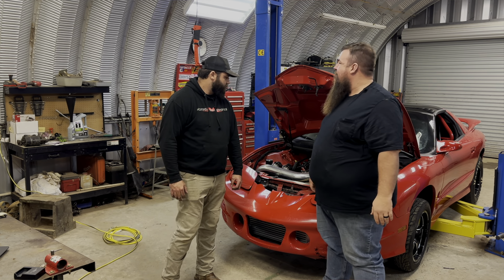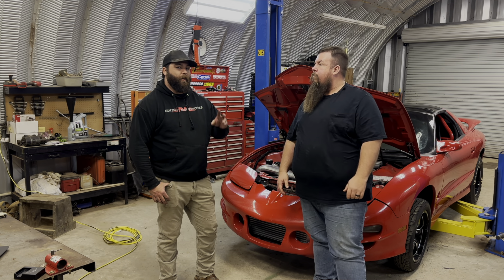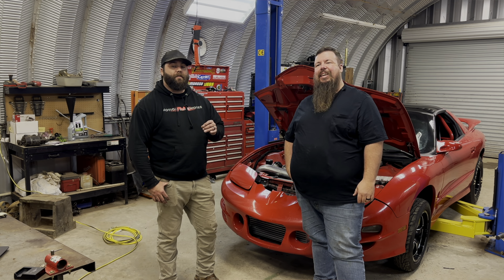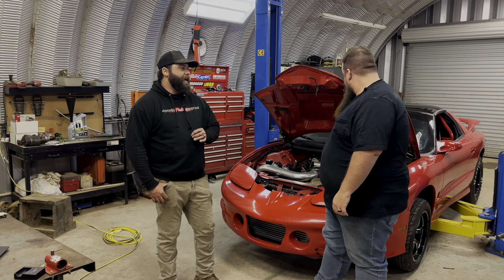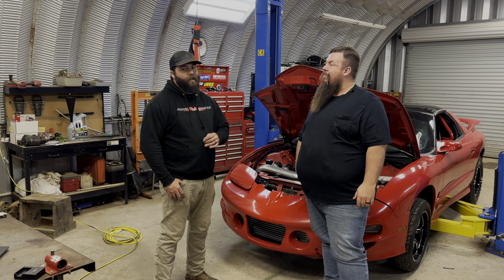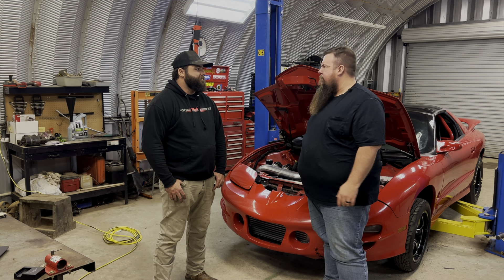James, now that you've finally got your transmission put in place, you want to get some final thoughts on that flex plate? Yeah, great piece. I did run into one issue — got everything bolted up and realized one of the holes was a little bit oblong. I'm using fairly large bolts provided by PTC, so I wanted to use what they provided. I had to take my drill and clean it up just a little bit. Once we got that done, I went to start the car and it made a grinding noise. We realized I needed to shim the starter a little bit. Threw a shim on the starter, put it all back together, fired it up — sounds great. Especially since it's about 35 degrees outside and this thing hadn't cranked in a month.